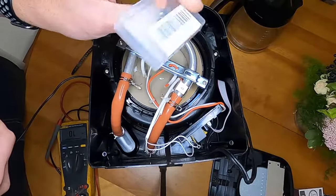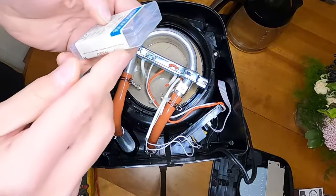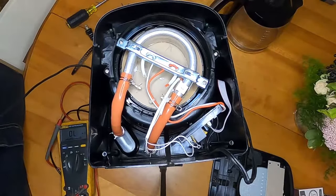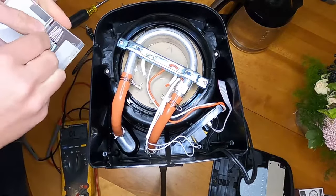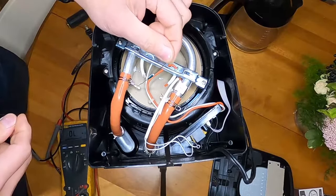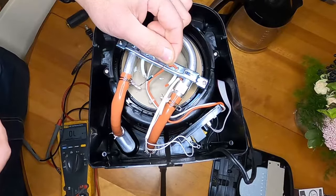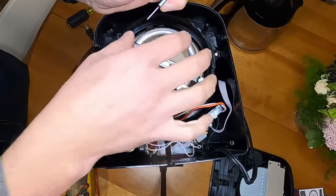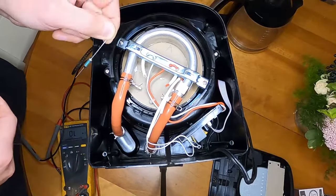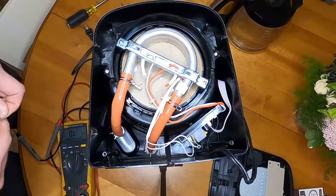So instead of buying a $70 coffee pot, I bought these replacement fuses from Amazon. I'll drop a link in the description. It was about eight bucks with tax and free shipping, took a couple of days, and it comes with a bunch of them. When you go to replace these, very important — you don't want to solder these back in. Your first instinct might be to just solder them in for a quick connection, but solder will melt from the heat inside, and the connection could come undone, short out, pop a circuit breaker, or damage the coffee pot even more.